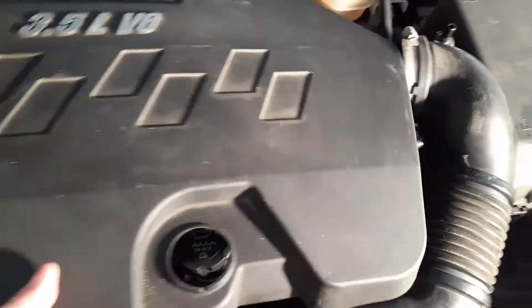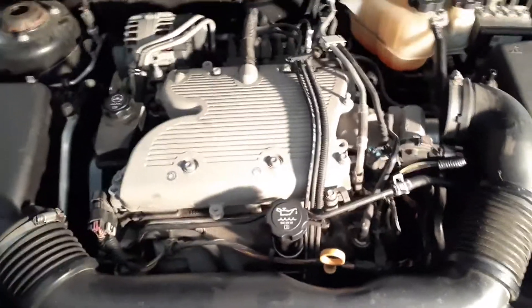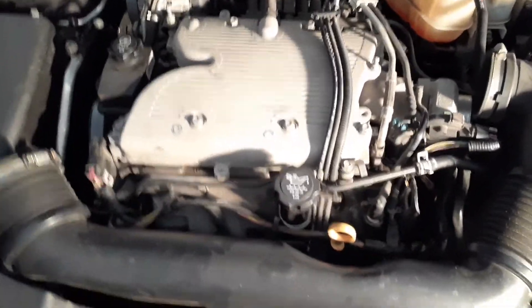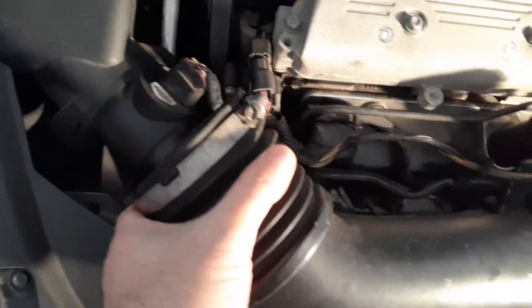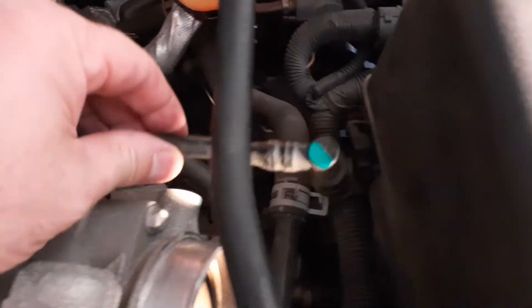So you just take your cover off here — I already took off the cover, I'm just showing you what I did. I took off this airflow thing that goes to the mass airflow sensor and the air filter. You take this off by unscrewing these. There's a throttle body and you just unscrew it from that. You just got to take this piece off on the back — that connects to this part right there. So you just take that off.